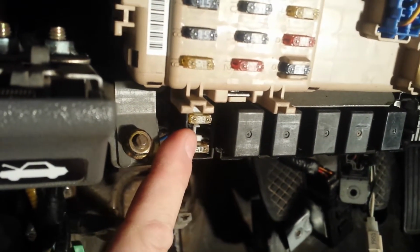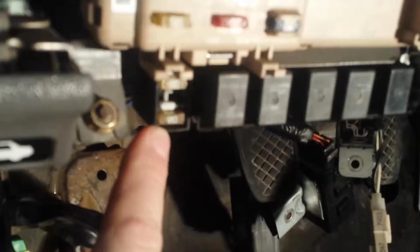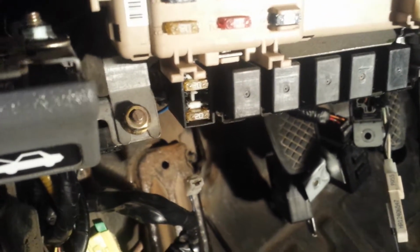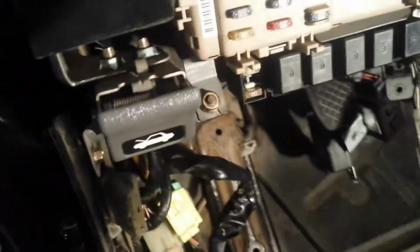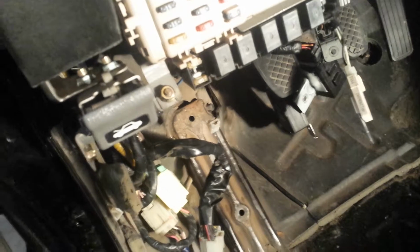So there were some extra wires over here in the Baja's harness that were not being used, obviously, anymore. Pulled them out, popped them in here, so I could put a fuse in it. And then I wired that back here into a constant 12-volt source. There's actually a non-used plug that has two 12-volt sources in it, and you can just tap into those any way you feel. I pulled a plug off of the Baja harness that clicked right into it and spliced into that so that I would have neater looking connections.